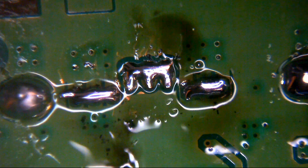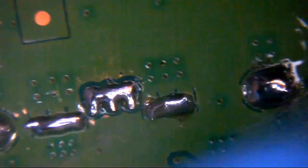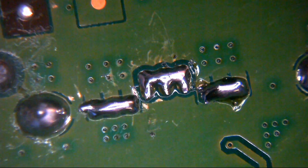So as we can see there, now we have that resoldered. So that's looking better than it was. I'm just going to get rid of the flux residue again. We'll ultrasonic these boards, so they'll all get cleaned anyway, but it just makes working on them a little bit nicer, a little bit easier if you clean up as you go. Doesn't have to be perfect, just something that means you're not going to put your glove down on the board and end up with a sticky finger full of flux residue. They're looking a little bit more presentable, which is good. We'll fill that damaged solder mask in around the edge, but there's no continuity there between the center power pins and those ground areas. So that's fine. So now we've got to do these.